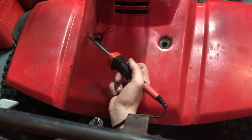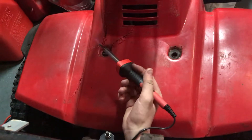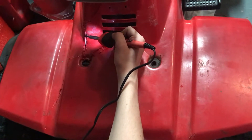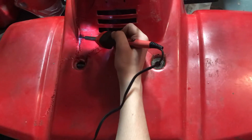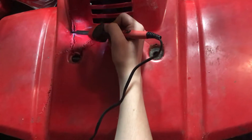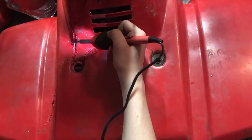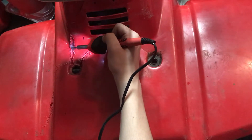So while we're waiting for those exhaust stubs to come in, I thought I'd show you guys how to repair plastics — just a little tiny section. You take a soldering gun, wait for it to heat up, and then just take it along and melt the plastics right back together. As you can see right here and here, I've already kind of done that. I have to go back over here again though. Just slowly go down, and you can clean it up a little bit better once you get it.